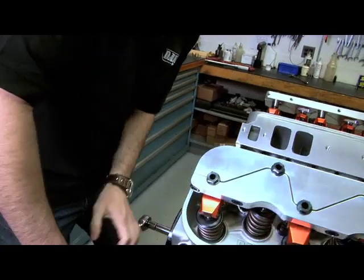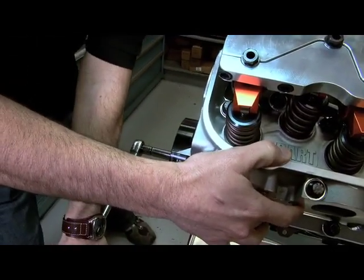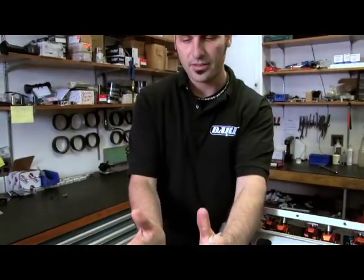One's going to be for mild build cams, but if you've got a roller, a big roller, you might want to try the second one. It's going to ensure your valves are lashed properly. So we're going to get TDC on cylinder number one, and you can hear the compression stroke there. So we're on TDC. Now we can set both lash for the intake and exhaust.